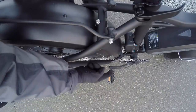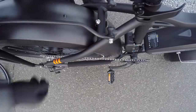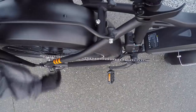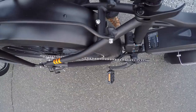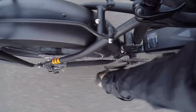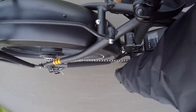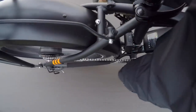From here you can see the 42-tooth chain ring with that nice alloy guide so it won't bounce off. There's a neoprene slap guard to protect the paint, a derailleur guard in the back protecting the cable and derailleur — it's a solid setup. The drivetrain with 11 to 34 teeth is a great spread; I'm used to seeing 11 to 32 or cheaper 14 to 28, so this is a great drivetrain with that DNP eco-friendly nickel-plated freewheel. Now pedaling in the highest level of assist so you can hear how quickly the motor responds.